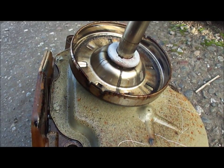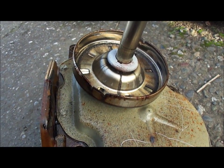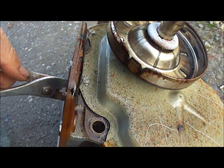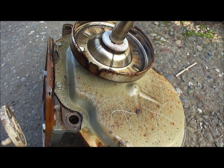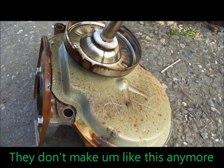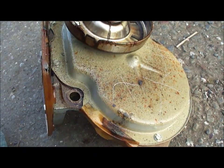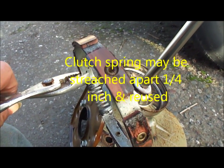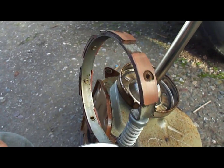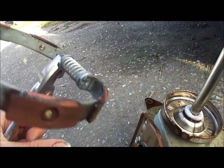The clutch was probably working good. The transmission just wore out — this machine was about 15 or 20 years old, maybe at the 300,000-mile equivalent mark. This is your clutch here. It does have some grease on it. You can tell how old it is by the clutch — on the new clutches they only put three pads on, but this one has six pads.